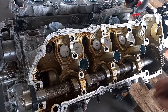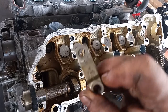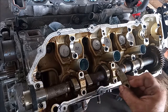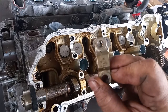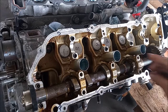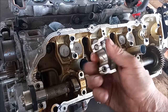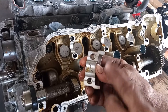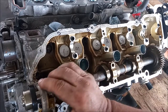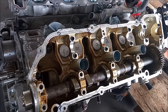I've placed these bearings just lightly in the position where they need to go. Each bearing has a label on it — this one is E4, so that's positions one, two, three, four. It has an arrow on it that points to the front, so that's how it should be positioned. This number one bearing cap is indicated to have some RTV placed on these surfaces here before the cap is installed onto where it goes.